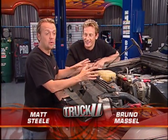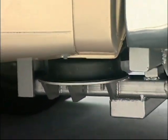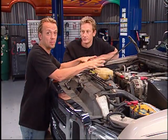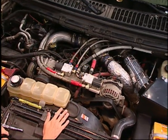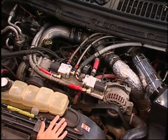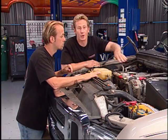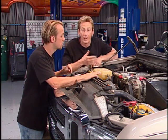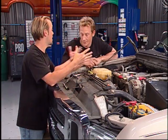I'm Bruno Massel. Not too long ago we did a suspension upgrade to the back end of this truck because the guy bought a new toy hauler and he wanted to pull it down the road, so we've got that taken care of. But now it's time for a performance upgrade in the front of the truck. To give this truck a little get up and go, we're going to put a little bit of methanol injection on it. What we're trying to do is increase overall horsepower by giving it a cool charge right into the intake. It's going to make it run more efficiently and make a lot more power by reducing EGTs. Why don't we head over here and take a look at how this kit really works.